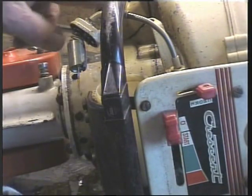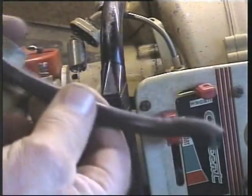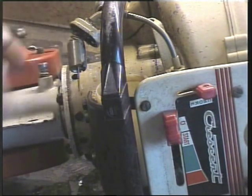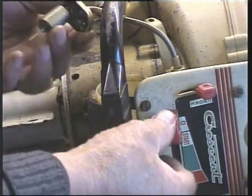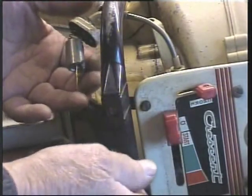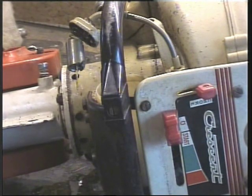I've swung the carburetor off and taken the body off, and that will get soaked. The pipe's quite hard, but I think it's going to be alright. I couldn't get the slide to move at first, and with the aid of a small screwdriver up underneath this part and some penetrating oil, now, as you can see, the lever moves perfectly okay. So at this stage things are going too good. Gonna go and have a cup of tea. Ha ha ha! Don't get carried away. Learn to make one before you break one, eh?